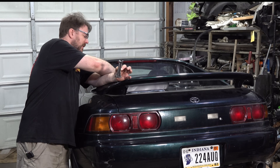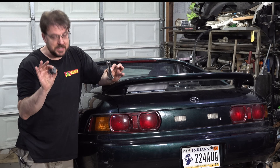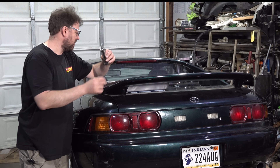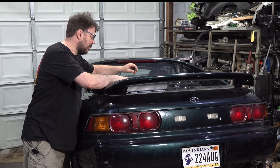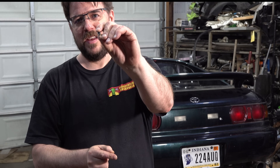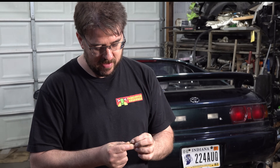That's a piece of connecting rod. It's another piece of connecting rod from a different one since it's the same piece here. But the most concerning parts are right here — this is a lash cap. Something happened in the valve train and this is part of a valve guide.